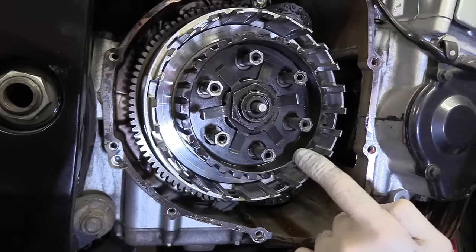I can't stress enough how important it is to make sure you soak them properly overnight in oil. All that will drain down, that's not an issue. Doesn't matter how messy it is. But if they're properly soaked, then they'll operate and they'll work correctly. If there's any dryness in there whatsoever, if any of this cork-based material is not properly soaked in oil, the clutch will overheat quite quickly, and that little tiny bit of blue you see, which is nothing, it will start going purple and yellow and green and all sorts of mad colours, and then the steel plates will warp and you'll bugger up your clutch. It's very important.